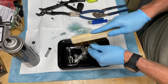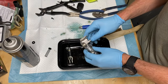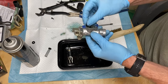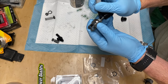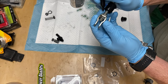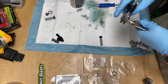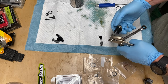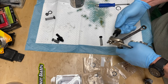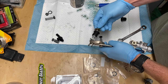I hit it with a wire brush to clean it up and it actually looked good as new, so I was glad I didn't go for the more expensive kit. Take out all the o-rings, and here's the adjustment for the brake lever — I marked it with a sharpie where it's already set so that when I put it back together it's easier to find where I started. From there everything came out pretty easily and looked in pretty good shape.